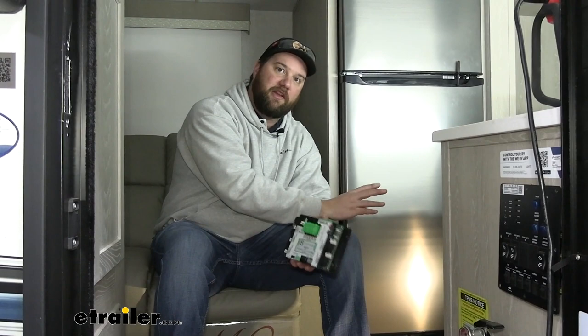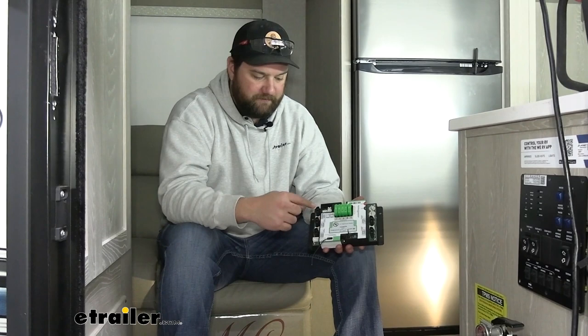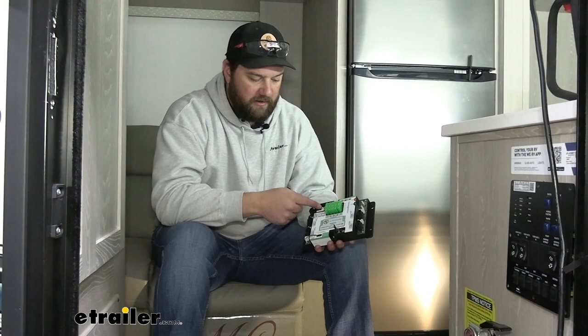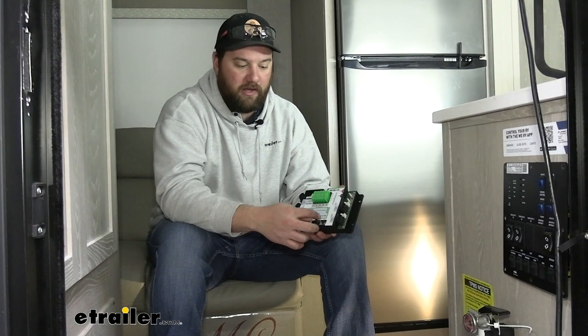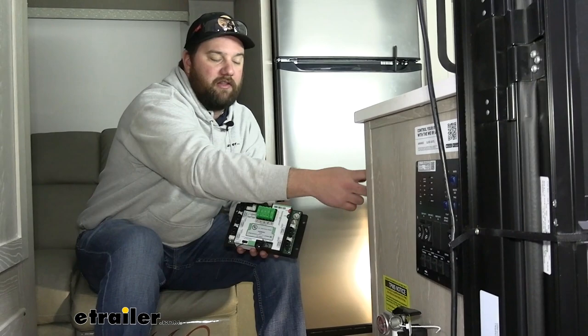To make the connections to the board, you'll have your power and ground, then left rear, right rear, right front, left front, and tongue jack connectors — all dual connectors coming from each harness from each of the jacks. Two connectors are your sensors, one is the remote wire from the outside controller, and down here is the control connection for your panel. We're mounting the panel behind the drawer underneath the oven, putting it out of the way.